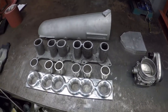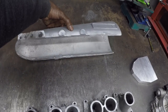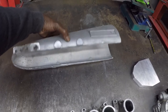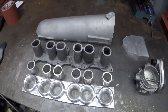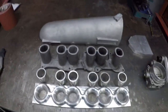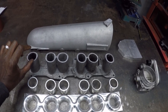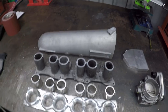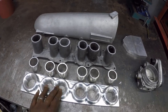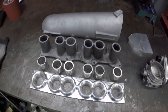Right, ok, so this is where we're at. We've got the inlet manifold which has been chopped down at the end and then all the ports cut from the middle. I was a little concerned about the casting on the inside but it's actually quite smooth so I've got very little work to smooth that properly. Then we've got the lower part of the VR6 inlet manifold which has been chopped down, and then these aluminium tubes made up just to space this by about 40mm — just to move the inlet manifold away from the fuel rail. And then lastly we've got this kind of bell mouth plate from a company called Nubworks in the States, which again just allows for a smooth transition of the air going into the plenum and into the cylinder head itself.